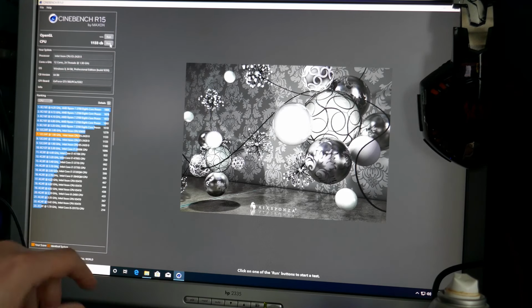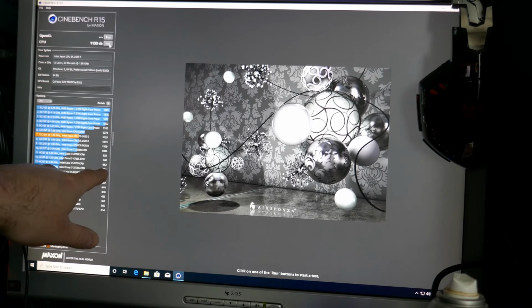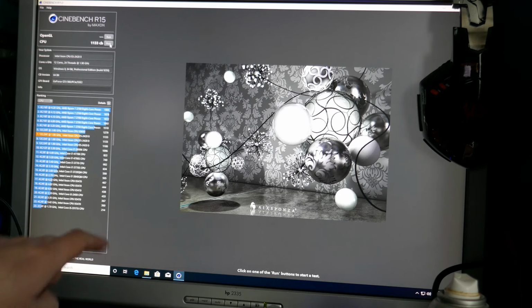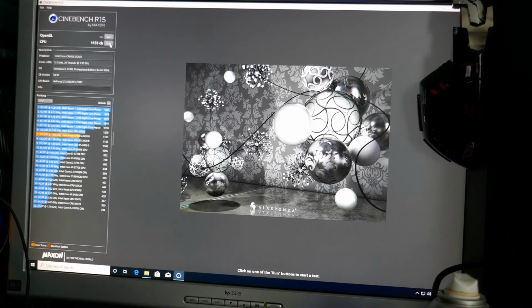So, I mean, we're doing pretty good here. We've doubled our performance, at least. The 3770S, which is what I was running in the system before I put the FX in there. The 4790S was what I put in my mom's computer. And looking at the 3770S there, that was 634. So we're not quite there, but close enough to government work. Doubled our performance there. It took 12 cores to do it. But that is a 3.1 gigahertz chip. So, I mean, clock speed does matter.